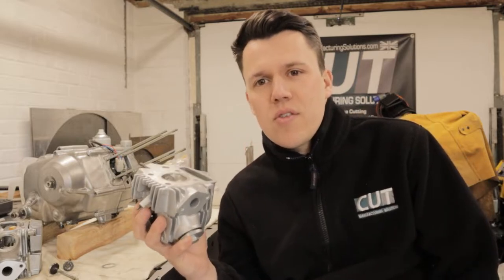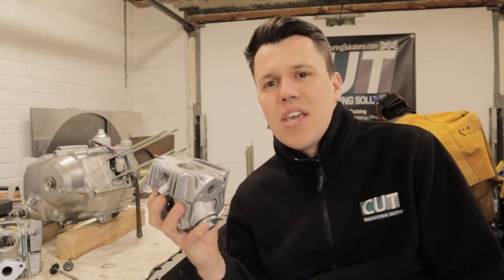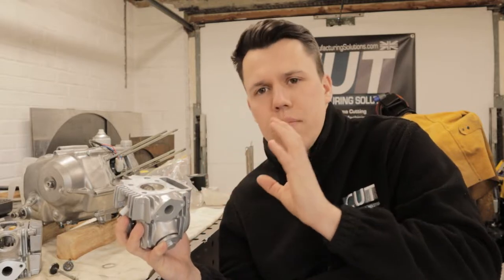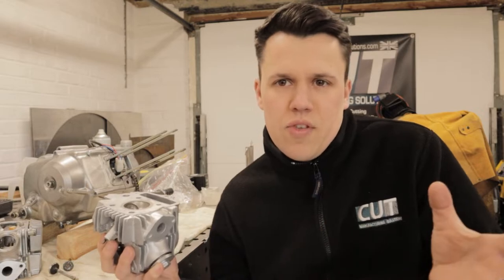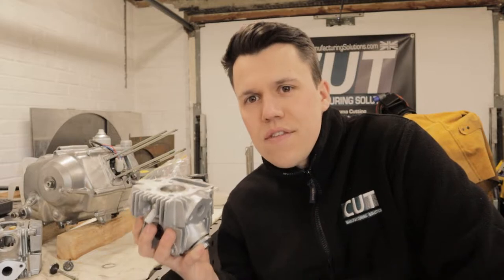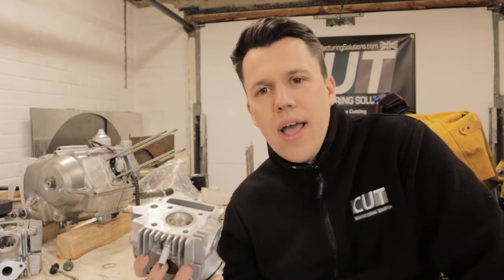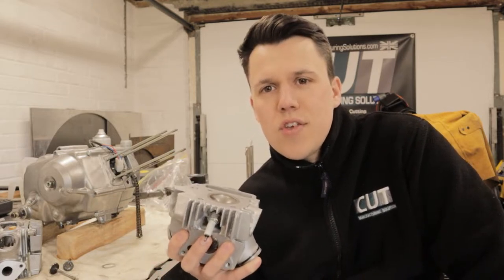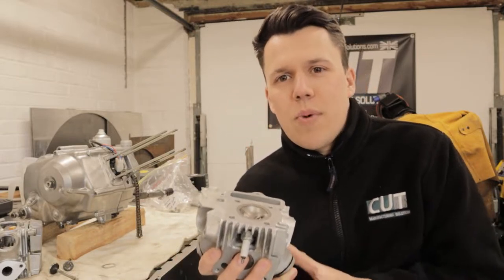This project went on hold for a few weeks as I spoke to and called people up. I was very lucky to find someone at a company called Two Wheel Restorations - Cliff there has helped me out big time. He had an old 50 head on the shelf, I sent him a new set of valves and he has blasted it, rebuilt it, and you can see right now on screen a comparison side by side how much better it is. That's what's been holding the build up and I'm hoping it's going to cure the poor compression issue. For anyone thinking about doing these builds, the cylinder head is a bit of a nightmare to source or fix.